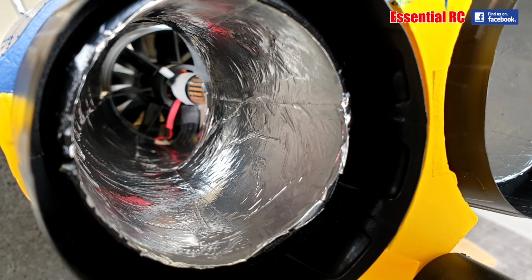The best way to do that is to use a carbon rod or a stiff piece of wire from the front to the back, and then maybe tape the black and red wires onto that and pull those through gently, so that they can be reattached to the controller at the other end that you're going to have in the fuselage. Final step in the install process is to disconnect the throttle cable from your receiver that comes from the speed controller and plug that into the connector on the afterburner controller. And then you're ready to go.